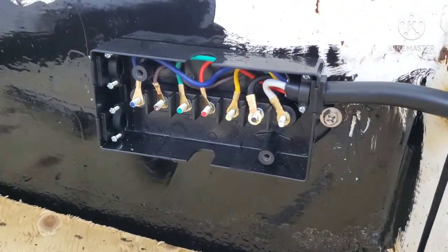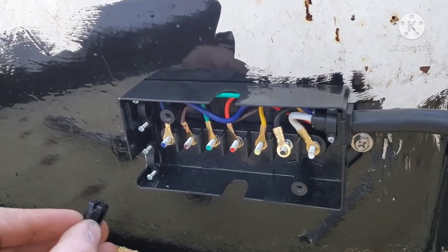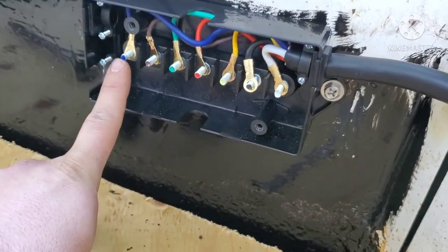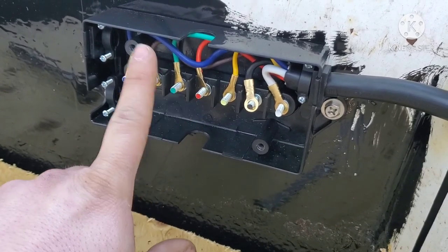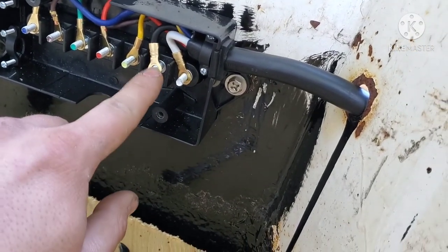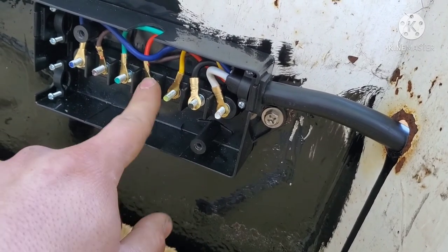Then all the power wire is going to run in through this grommet here, which obviously you change out, because this is just a face. And then tie them in, and then put them all to their regular spot. So there's trailer brakes, signals, tail lights, like a running light. This is for charging a battery for the emergency trailer brakes, and then grounds and...